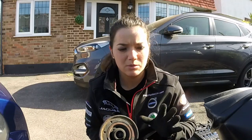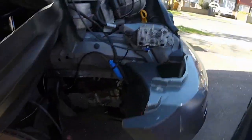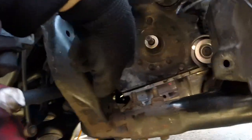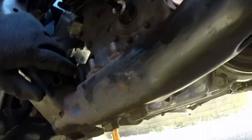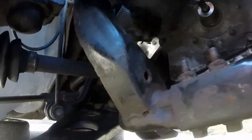It's a lighter one, and the old one is really heavy. Anyway, that wasn't actually my main reason for doing all of this. The main reason I wanted to get in there was to change the tensioner. So now that I've got the pulley off, I can actually fit in and take this whole tensioner assembly off. I've got one bolt at the top, another bolt there, another bolt here, and there's another bolt at the top somewhere. So now I can get access and take this tensioner out.